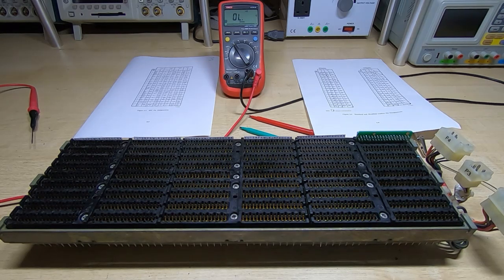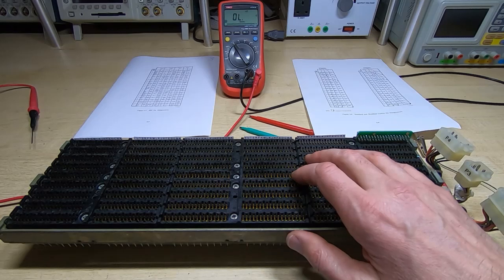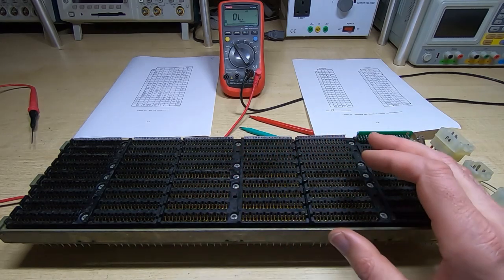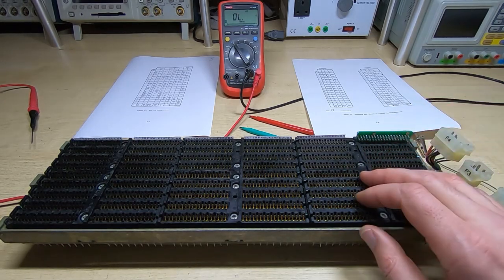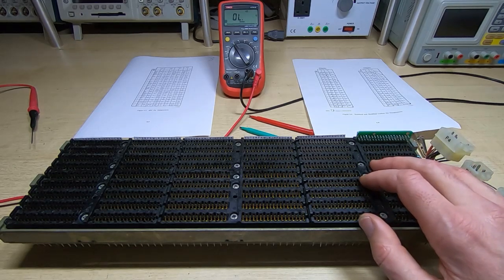In this series of videos I'm attempting to repair and restore a PDP-11/34A vintage computer. So far in this series I've been through the basic machine, I've got it booting up, but I was having lots of problems. Ultimately I've got to the point now where I need to deal with problems being caused by the backplane — it's making the whole machine behave in a very flaky manner. I move boards, touch it, and suddenly it crashes. Having looked at this under a microscope I found all sorts of problems with it.